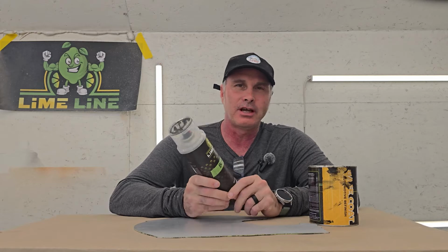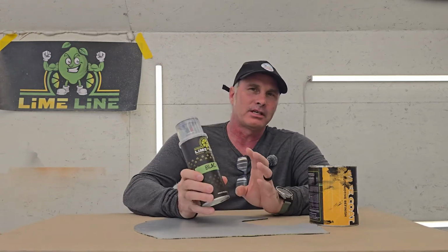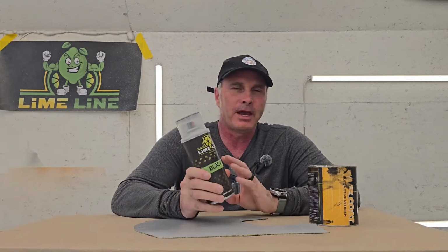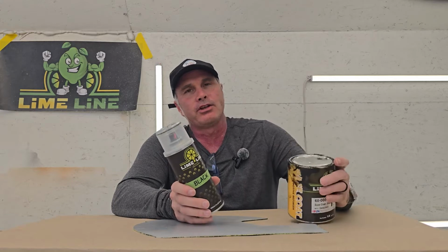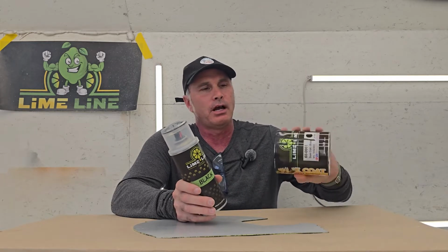Okay, we're back for one quick last comment that I didn't mention when I was rattling on there, just so everybody is on the same page. This is a urethane base coat, like what comes in this can here. I thought I'd show you what I'm talking about when I say it comes in a can, just like this, that you would mix with reducer and spray out of your spray gun.